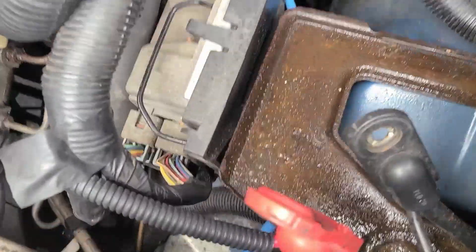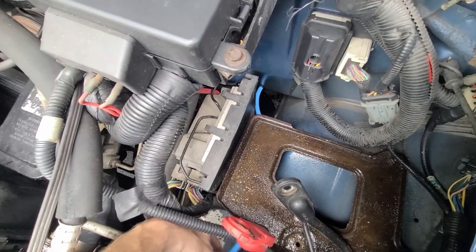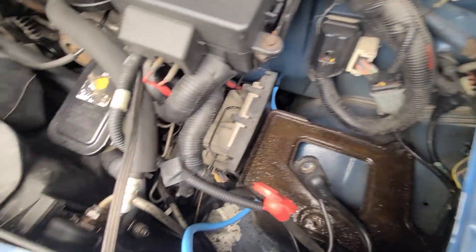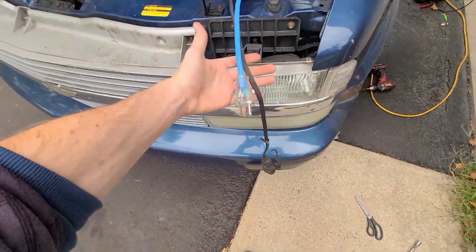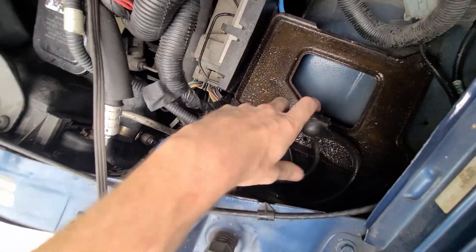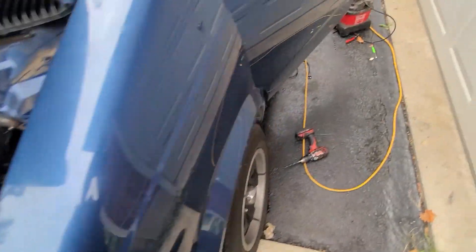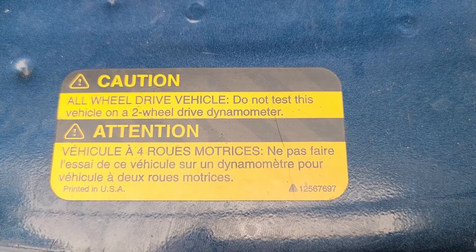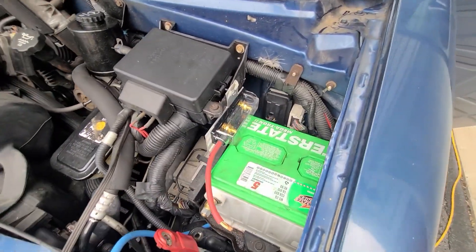You can see both grommets here with a little bit of sealant on those, making sure it's completely dust, air, and water tight. I've got the shore charger wiring under the battery box here — I'll put some loom on that once it's back in stock at Princess Auto. That's the block heater cord there. I'll run those both together and stash them under the battery box. There's tons of room up front — some people put the diesel heater tank in there.